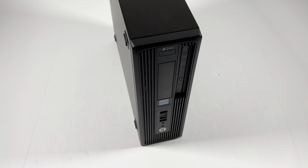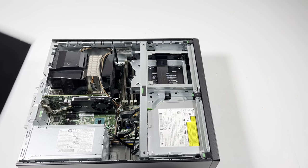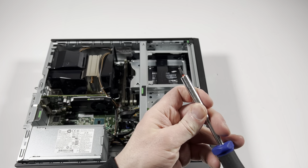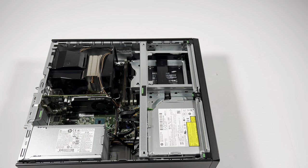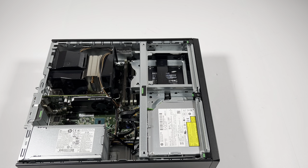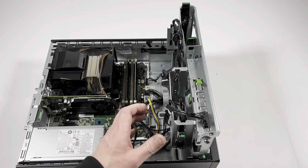What's going on guys, this is an HP Z240 workstation and I'm going to be doing upgrades. I'm going to switch to the other side. You'll need a Torx T15 screwdriver, or if you don't have one, a flathead screwdriver will work fine. I'm going to upgrade the video card, RAM, CPU, and a solid-state drive.